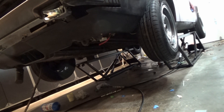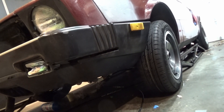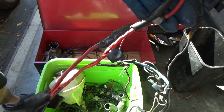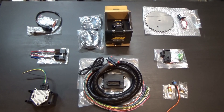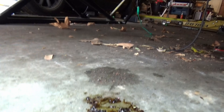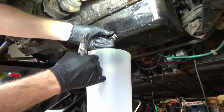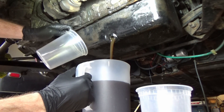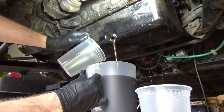This was supposed to be its first time under its own weight in a year, its first time driving in over 20 years. But then I blew it — literally blew up some of the electrical components. The ECU shorted out, I fried some things. This wire here basically melted, and this essential part called the double relay let out some purple smoke. The plan was to put in an aftermarket ECU, but on the day of the install I noticed something suspicious — what looked like coolant mixed with oil pooling up. To confirm my suspicions I had to drain the oil, and not only was it discolored, it had the consistency of jello. So the electronics were shot and the engine also needed a full rebuild. That's when I decided to cut my losses and do an EV conversion on the car.